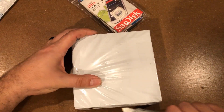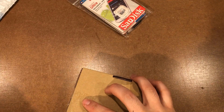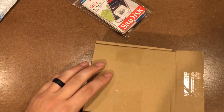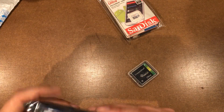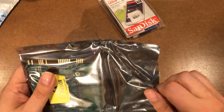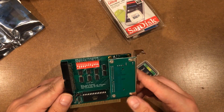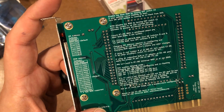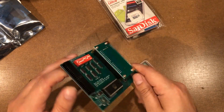I think this is exciting. I'm going to open this up — this is the reason why I'm doing a mailbag at 7 o'clock at night, because I want this bad boy. This is something that anybody who deals with retro computing will appreciate, especially if you deal with the older stuff like 8088 type stuff. Oh, it's beautiful. This is a XT IDE. The deal is most IDE cards are 16 bits. This is by Blue Lava Systems — they deserve a shout-out for this piece of kit. Silk screened, all the jumper settings, all the information on the back. You can plug this in a single 8-bit slot on your legacy computers and get both a compact flash and an IDE.